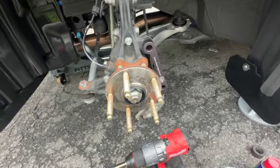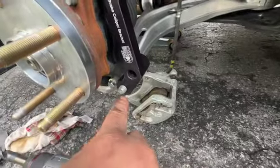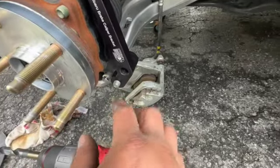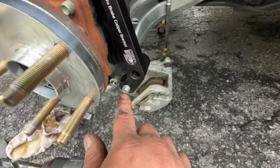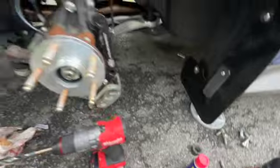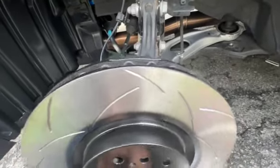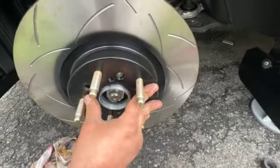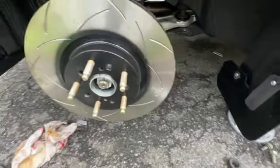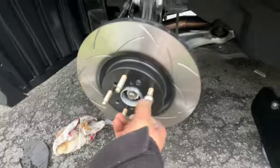A little bit of anti-seize on the front side and back side of the plate, and I also put anti-seize on the bolt — when you're screwing metal into an aluminum product, you don't want the dissimilar metals to seize. Next goes the rotor. These are DBA rotors — they've got two bolt patterns in them, so just use the five correct holes and chuck it on. Then run a lug nut down a wheel stud to hold the rotor on while we work on the other stuff. Everything's seated nice and straight.